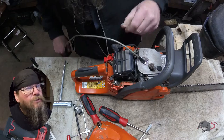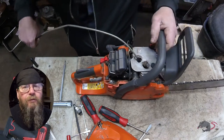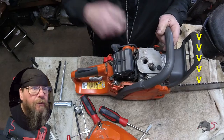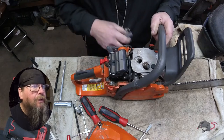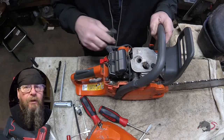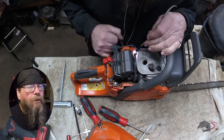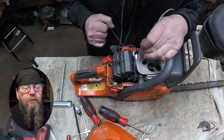In this case, what do we see in the cylinder besides a piston? It's clean, looks good. But when we pull on the cord, a big clue pops up — the chain is turning. If you have a situation where the chain is turning while you're trying to start the saw, it's going to be a lot harder to start. You have to pull over the whole weight of the chain while cranking the engine, and a lot of times you won't get enough speed to actually get it started.